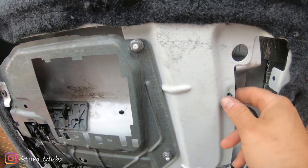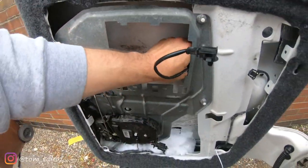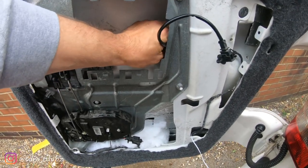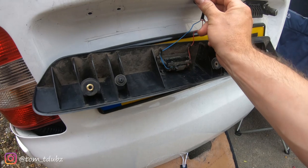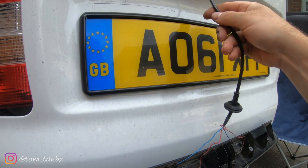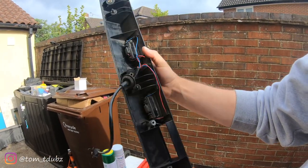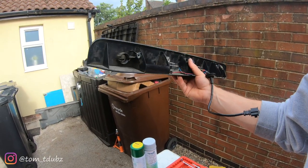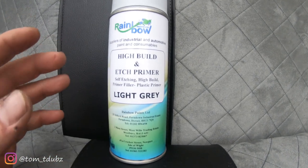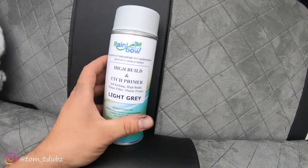It's really tricky to do stuff with one hand. So we're going to get that off, pop that off there, pull it round this way, and take out the grommet that's in here. Once you've done that you can carefully pull that off. Go for the grommet on this side, then thread your cable through. That is it — really straightforward to take off. We're going to release the number plate lights themselves, get it all cleaned up, and then look at spraying it with primer to start with.